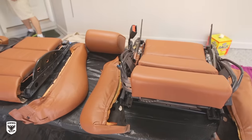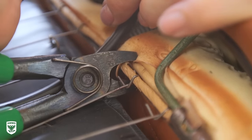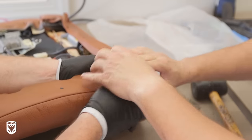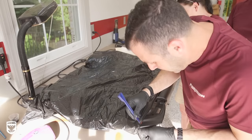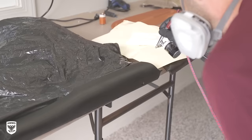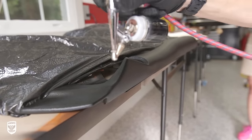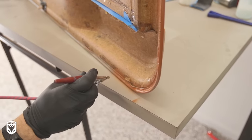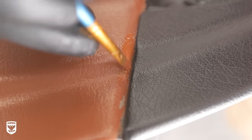With two layers of top coat on, the team reassembled the seats using hog rings, pliers, and lots of patience. Meanwhile, Brian masked off the door panels to dye the uppermost part of the door — where you would rest your arm — in preparation for a fresh layer of black to create a two-toned door. Afterwards, he touched up hidden spots with an airbrush and a small paintbrush when necessary.